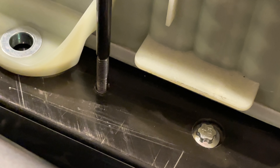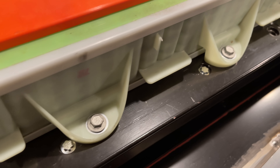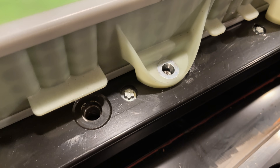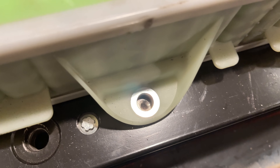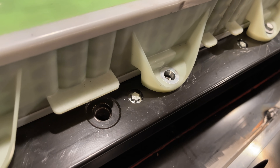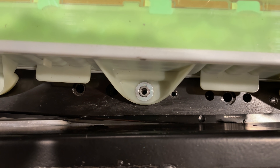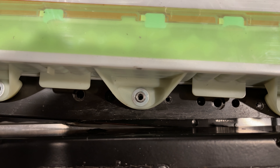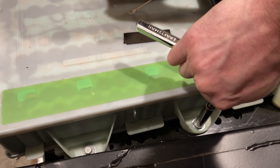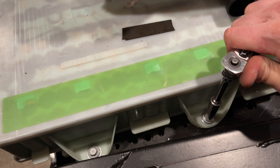You don't usually want to bolt directly into tapped aluminum for anything heavy or important, like a 200-pound high voltage battery module. These modules are heavy and I'm going to need some torque to keep them in place. I reused the bolts that were used in the Tesla case — they're much smaller than the holes. I think they may have originally designed this with M8 or M10 bolts in mind and then realized M6 works just fine. It's nice for me because I don't have to drill the hole in the exact right spot. I did add a couple of spacers on each side just to keep the modules in the right location while bolting everything down.